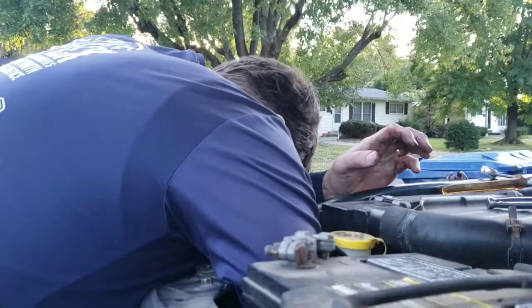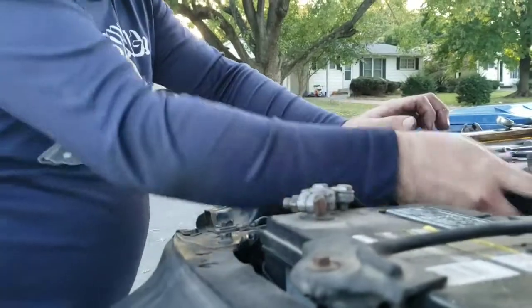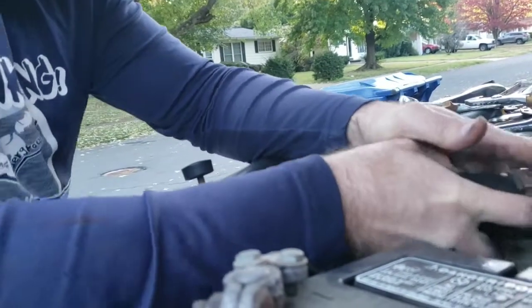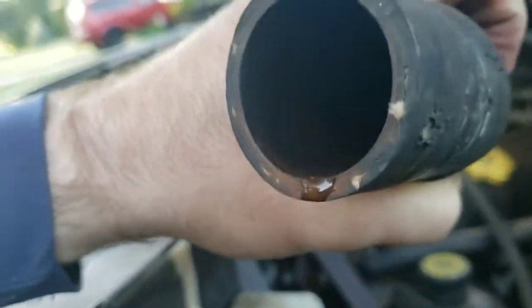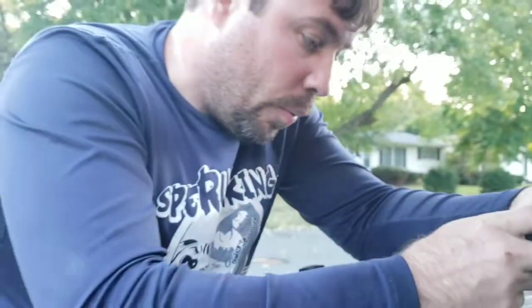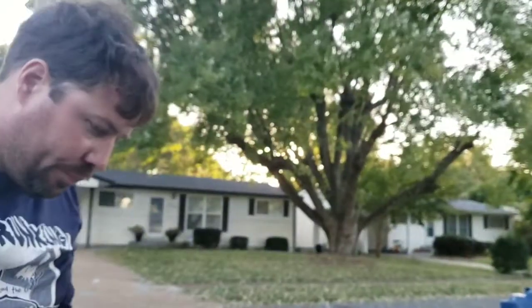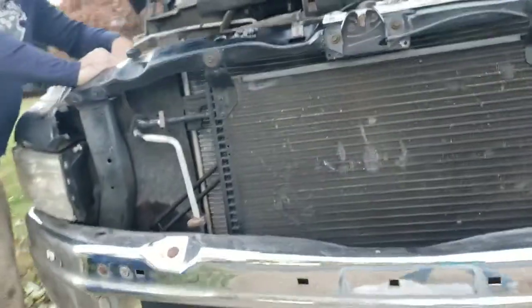It's just water, so for me it's not as bad. If you've got coolant, try to make sure it's not draining on the ground. It'll take a long time draining this way. A little dirty water — it's a little cakey, grossness. It's not that bad for running Bar's Leak in there, and I run water all summer. I'll flush it with water, clean it, seal everything up, and put real coolant in for winter. You don't want water only in your system when winter hits, because you will not have a radiator or possibly a cracked block.